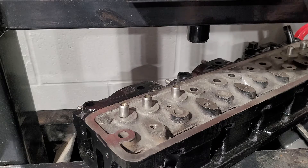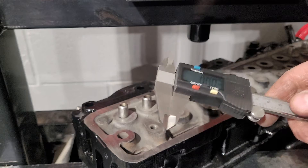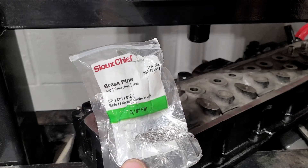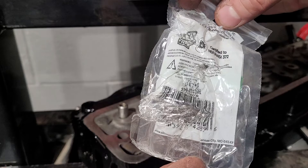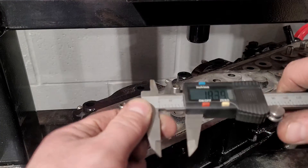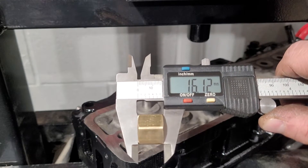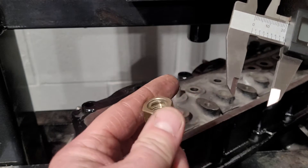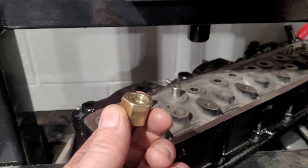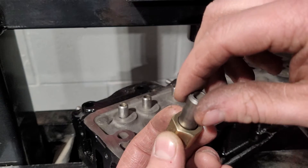So what do you use? Well, let's go back to Home Depot. I went to Home Depot and I took this with me and I started measuring all nuts, washers, and everything to find what's the best thing I can use. This turned out to be the best — it's a brass pipe cap, it's a 3/8 inch. I measured it and I was looking for something that was pretty much in the 16ths. When I measured it: 16.12 millimetres. That's pretty good. Now, since this is a cap, it's threaded on the inside, so I had to drill out the hole — big enough that the valve guide would fit in. There's a little bit of play, but not too much, and I know it goes in.